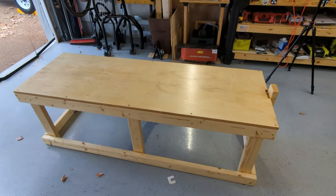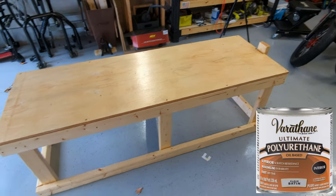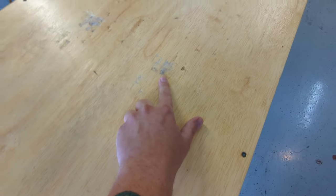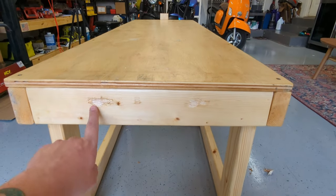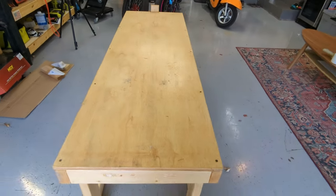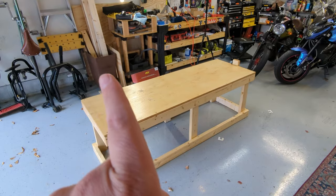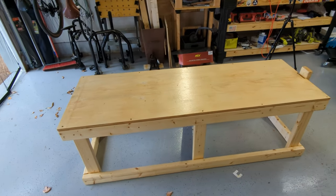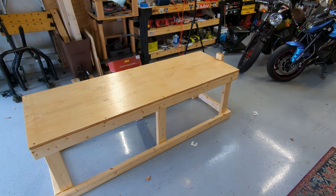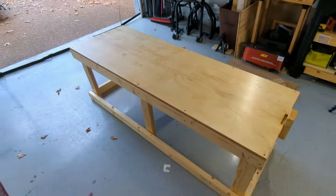I run it up under power. I coated the whole thing in brush-on polyurethane, which gives it more longevity and holds up to dirt, debris, brake dust, and grime. I'm putting the big scooter on the metal stand, so it's getting a little torn up where the stand sits, but that's not really a big deal. I'd recommend going 76 inches long, because scooters roll back when put on the center stand. You can put in eye hooks to tie the scooter down, or strap it around the bottom. With polyurethane coating and deck screws, the table supports all the scooters just fine.